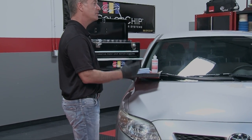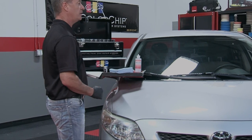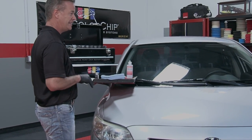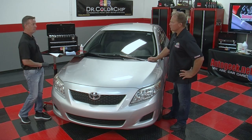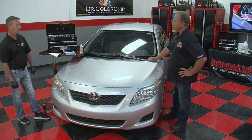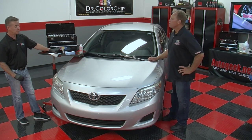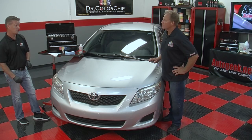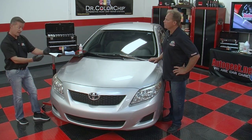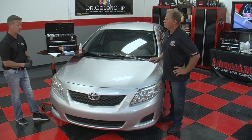Just repeat the process. Yeah, it is a very delicate, soft, gliding motion that you're using over the chip. It's not a digging, pushing in with your fingertip motion. So if you do make a mistake, it's easy to recover. Absolutely. That's good. Very, very simple. Okay. That paint's dry. Now, what I will do second is show the squirt and squeegee method. Okay. And then we'll come back and remove this excess paint and do the final sealant step.